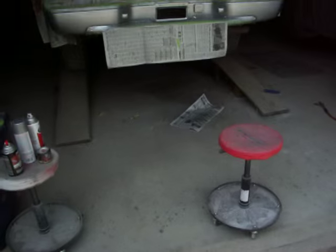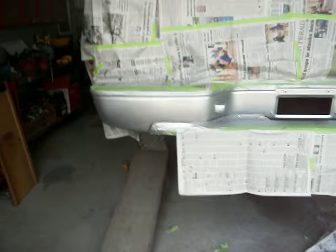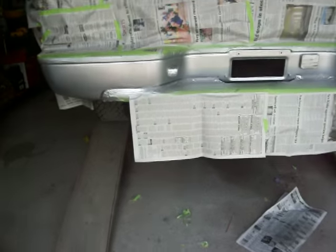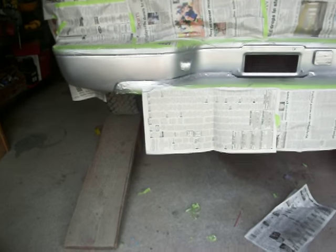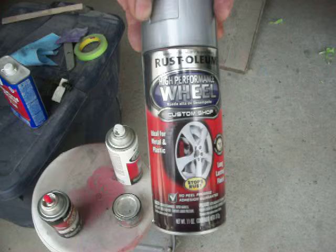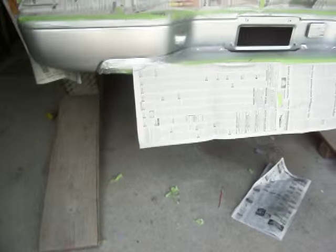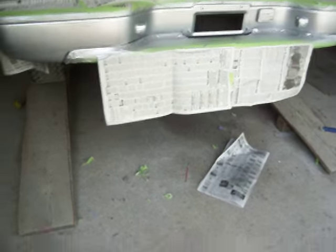I have to wait half an hour since I painted that. It covered pretty good with about three coats. You've got to put light coats on because it'll run real quick on you. This stuff is nice — it seems to be a good paint, but it runs quick. So you want to put very light coats on and then a heavy coat towards the end, at a ten-minute interval.